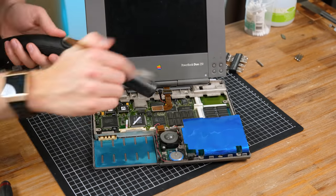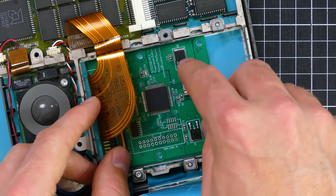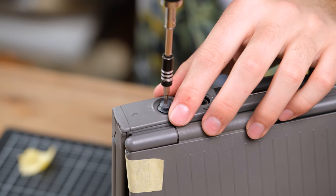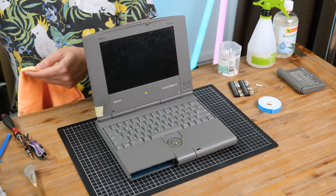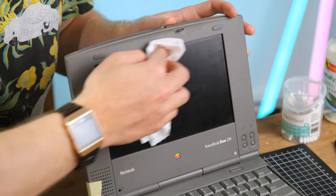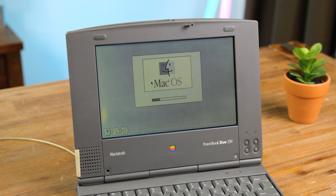With that good news, let's clean out the PowerBook Duo. The rubber parts were surprisingly still really strong but a little bit grubby in appearance. Since the new hard disk doesn't have any mounting threads I simply held it in place with double-sided tape. I think the rubber strips on the sides are there to avoid scratching it when you put it in the dock. The top casing can now be clipped back in place. There are small feet that raise the keyboard and cover some of the few ports on this laptop — in fact there are basically next to no ports on this PowerBook at all. I gave the casing a wipe down with some eucalyptus oil. Honestly there is next to no wear, so I'm wondering if this was primarily used inside the dock. The screen however was pretty dirty, and I made sure to be very gentle as I'd hate to damage this very uncommon laptop. Any gunk built up on top easily came off with some spray and wipe.